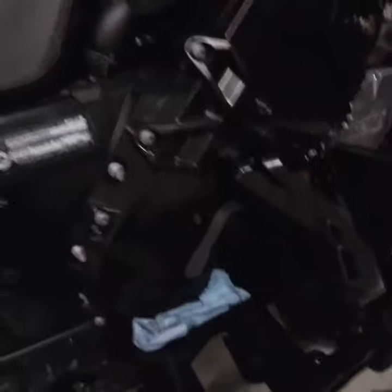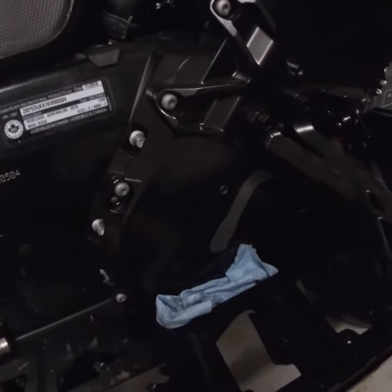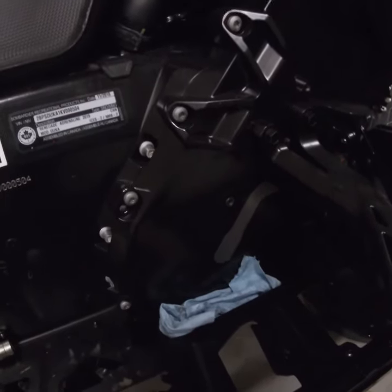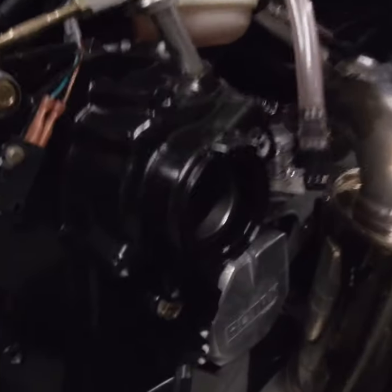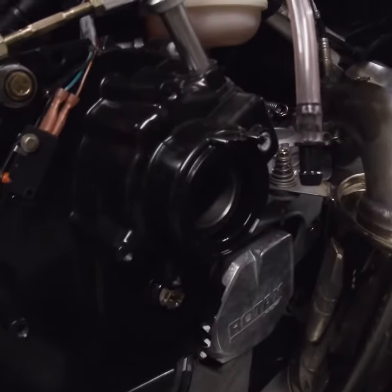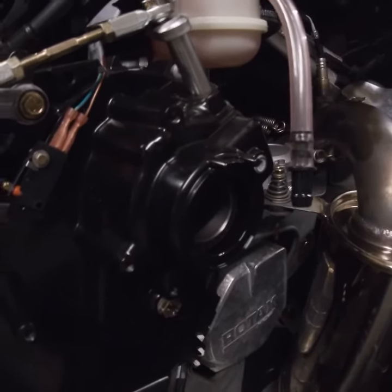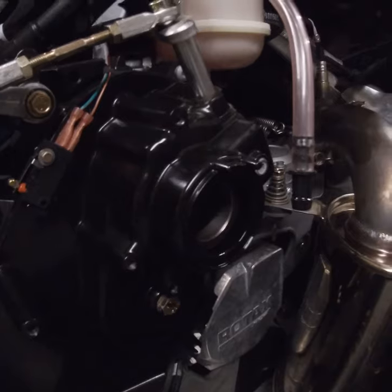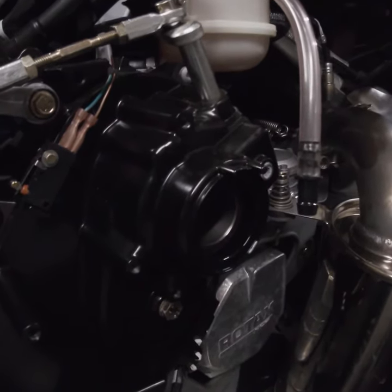That's about the only step there — filling is that easy. When I saw the oil start to come out I tightened the cap back up to 6 Newton-meters and put it back on. The next step is just to reattach the rubber plug and slip the breather hose back in, and you're finished with the job. Good luck with your next projects — stay on the right side of the trail and keep it safe!